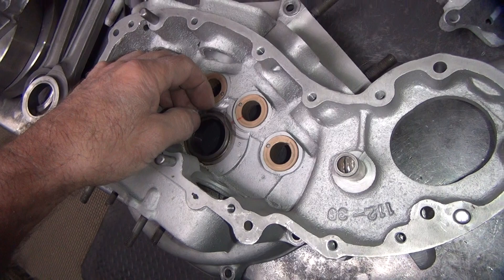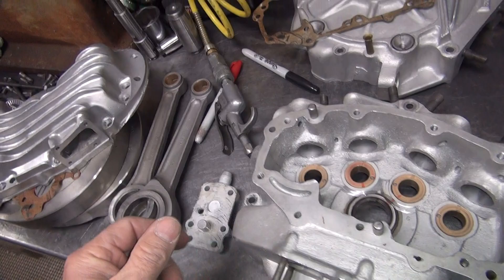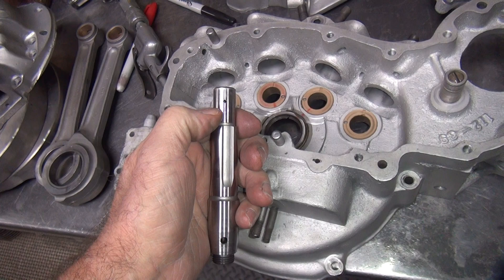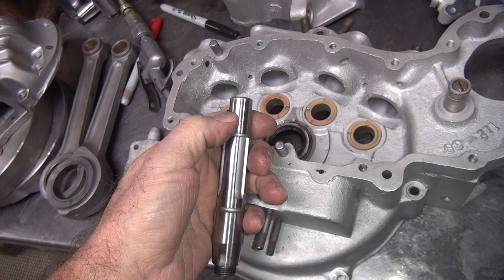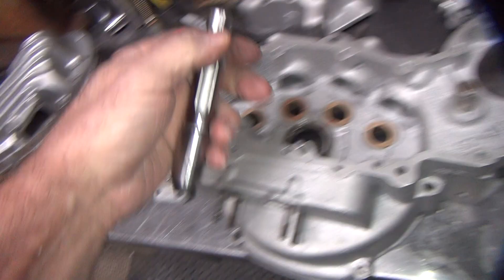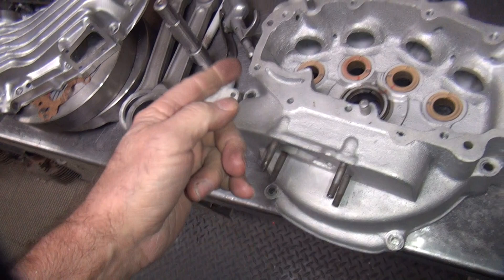If you made out of a 360 oil system, I don't see why it really makes any difference because all the volume is going to go into the motor anyway. How much are you going to slow the volume down by just pressurizing this right here? To a certain extent, you'll slow the volume down because it'll build up a head of pressure in the pump. If you had this unrestricted and let the flow go right into this crank, it wouldn't have any pressure in this motor — I doubt if it would shut that idiot light off. It would just suck everything. So whatever that pump makes would go into the crankcase, and this would have to suck up 100% of that volume back to your oil tank, or you'd have a wet sumping problem.